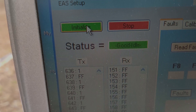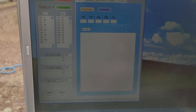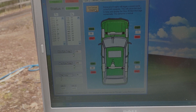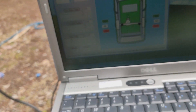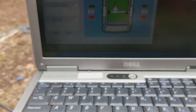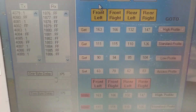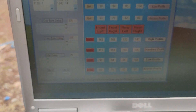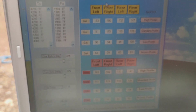Ignition on. Look at that — it now has a good idle. Didn't even have to initialise again. Sensor heights: I've parked the car on flat ground. I'll get these little metal tubes and simply drop the car down onto them, and whatever the sensor says, that's what I'll calibrate as. So under calibrate, hit read all — currently entered for each height. I want to change it to whatever it actually is when the car's dropped onto the bars.